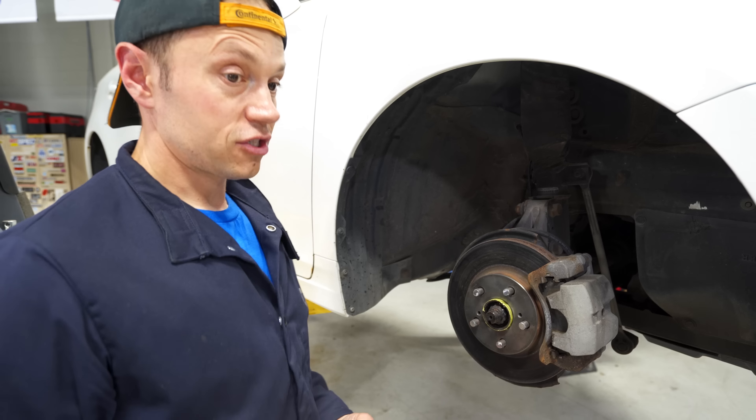The torque amount — I've got this set to 85 foot-pounds. We couldn't find much on the internet that told us the proper torque amount; it just says torque it to your stock lug nut spec. These ones don't have as much surface area, so I don't know if you need to go more, or should I be using Loctite? Somebody mentioned in one of the threads to use Loctite. Since I did ruin a set of lug nuts, I've got a new set here.